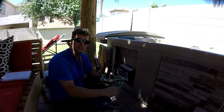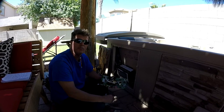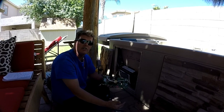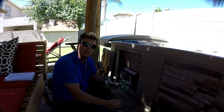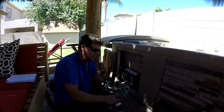There's a breaker over on the wall — I've already shut it off. I will be testing it to make sure the power is shut off here at the hot tub, because you never know. There could be a breaker on the wall that you think runs the hot tub and you find out later that breaker had nothing to do with it. Always double check before you stick your fingers inside.